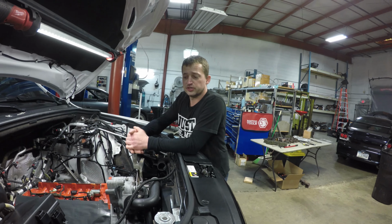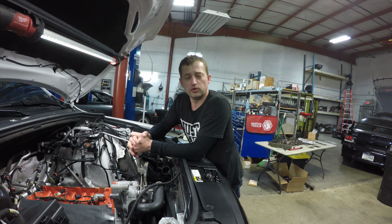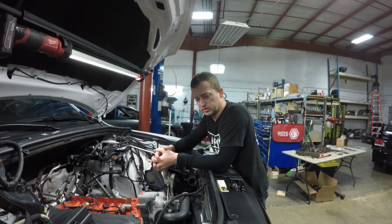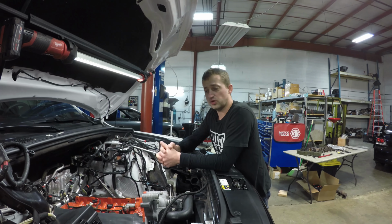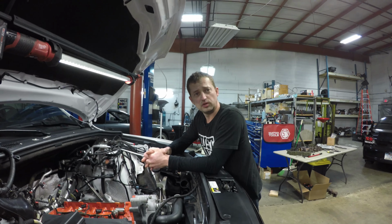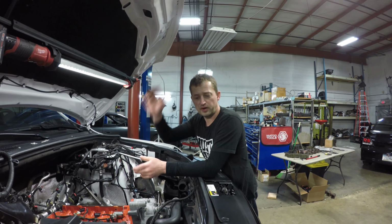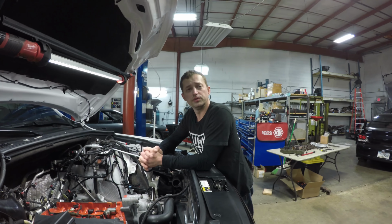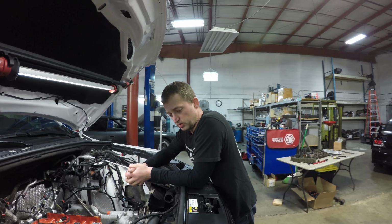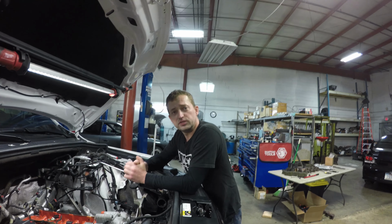For street use, yeah. If this was a race truck, this would need a bigger turbo, bigger stall converter, et cetera, trans brake. And then the list goes on. But if you're trying to build something daily drivable that has power throughout the RPM, you put a little bit smaller turbo with a smaller exhaust housing on it, so it lights up faster. It doesn't make the peak horsepower, but it's a lot of fun on the street. Yeah, it's enjoyable. And some people out there will agree with me that it doesn't take a million horsepower to go 9s. I totally agree. Clever setup.